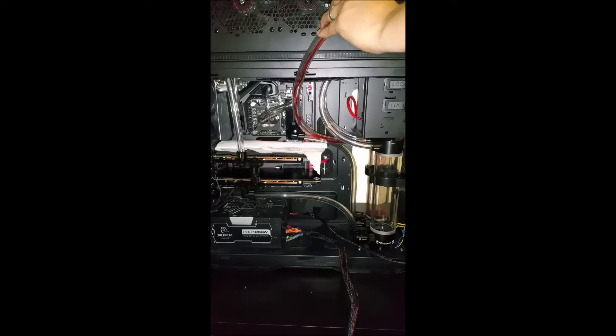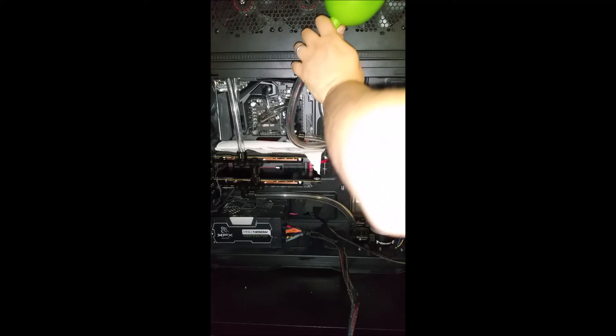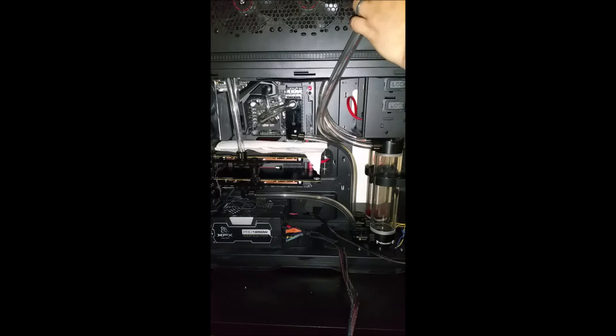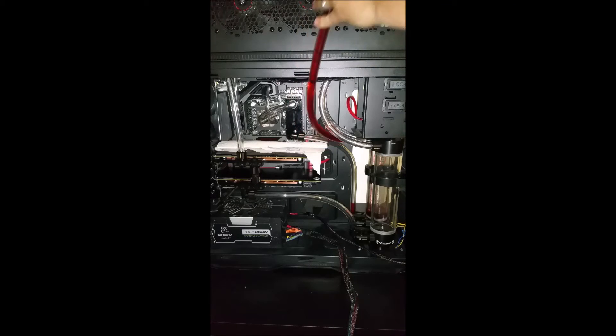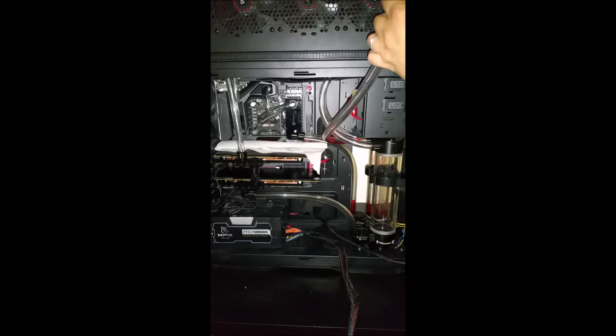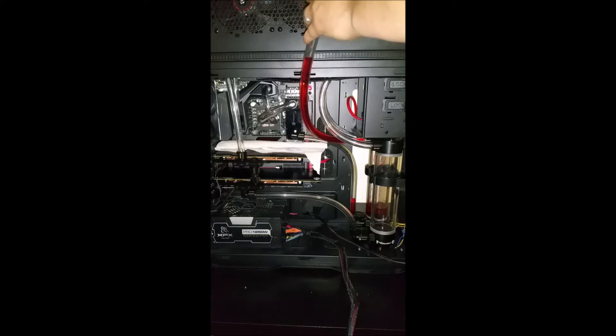With the tight spaces in this build and the size of the reservoirs, it's going to take a little bit of time to get this filled up, so we're going to put it in a little bit slowly. Since we're filling the top inlet port, we want the level as close to the top of the reservoir as possible — not completely full — so that when we turn the pump on it will pull all the liquid out and you just fill it up to capacity. That way when water comes in from the top inlet it won't splash down towards the pump and suck in bubbles.